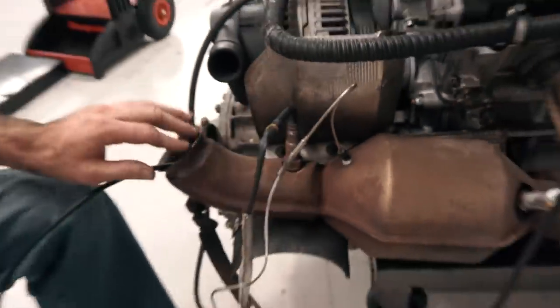For those of you guys that are out killing oxygen sensors, that's where your O2 sensor lives. But if we move past it, we can actually see the completely blown out catalytic converters in there. If you're wondering what this little stick is right here, we can stop looking at this thing and we'll come look over here. This is actually the temperature probe for the catalytic converter.